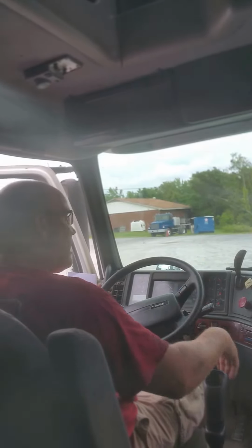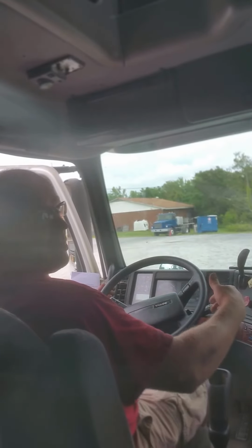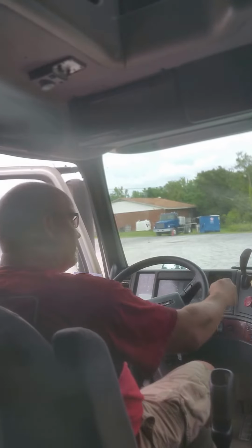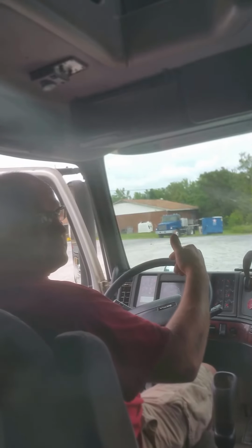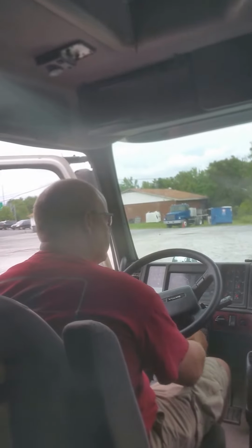All right. After you check that, you're going to fan the brakes down. Make sure that the lights and alarms come on at or before 60 psi. Once you've accomplished that, you're going to continue to fan the brakes down to make sure the buttons come out between 45 and 20. Okay, everybody good? Good. All right, there you go. Bam.